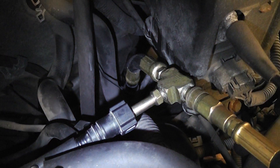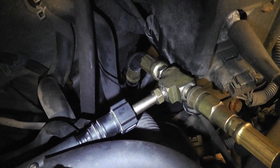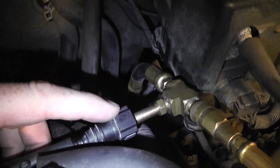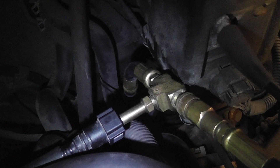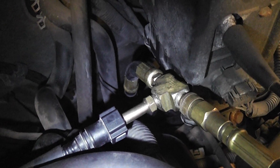We're going to do the cleaning service now and I wanted to show the gauge connections. We are teed in — this is the fuel pressure line that would originally go down to this location. We have a T in. This is our pressure gauge attached here, so the gauge is teed into the fuel rail.